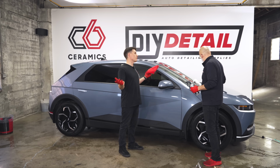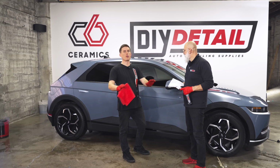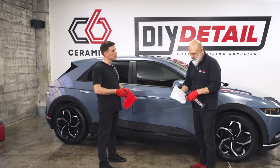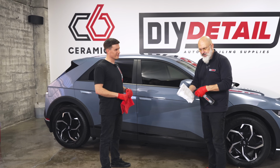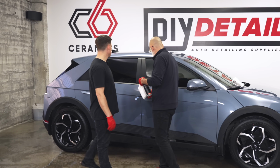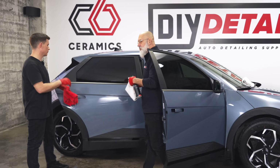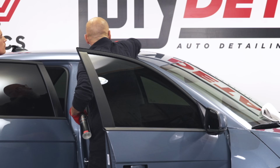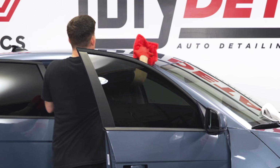It's important to have two towels for the panel prep. A lot of people want to just use one, spray panel prep on the surface. Those are a couple of big no-nos. Right, you want to spray the panel prep on your towel. And I love a short nap towel for this. I'm putting a bit on here, and the reason is I want to float any contamination that could be on the surface, and then Nick wipes it away with a towel before it dries. So this is a pretty quick process.